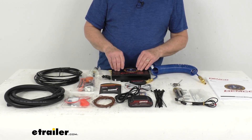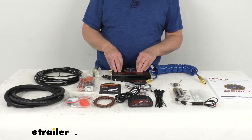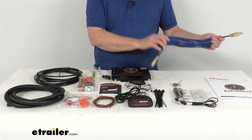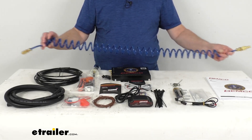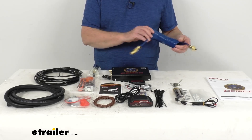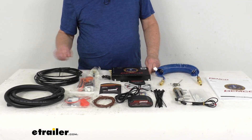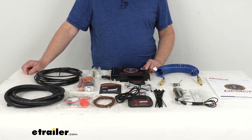This is a truly proportional system. It will use the air pressure from your RV's brakes to apply the brake pedal in your car. The coiled air hose right here is what will connect your air assembly in your RV to the operating unit in your towed car. When this is fully extended, it's about 7 feet in length. This does give you no false braking — the coach air brakes must be activated for the system to apply your towed car's brakes.